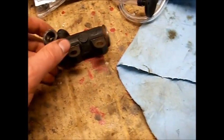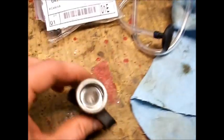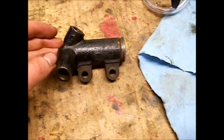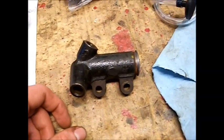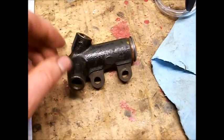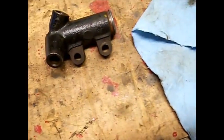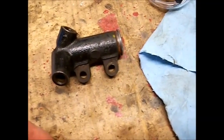Good idea — you can get it directly from Toyota or whatever OEM you have. Back to the problem: how do we get this piston out of here? One suggestion is to use compressed air and blow into one of these holes here, and that pushes the piston out, forces it out. But I don't have compressed air, so the other option is to pull it out.